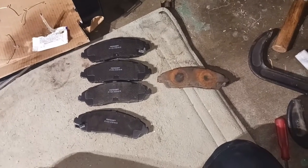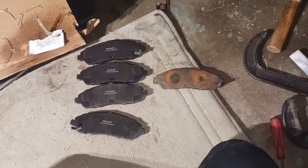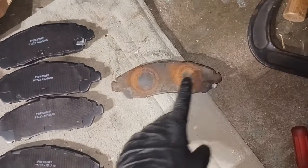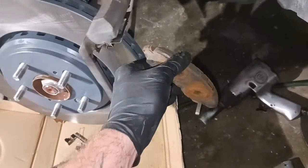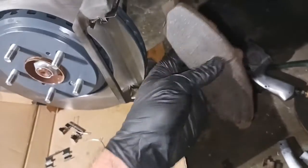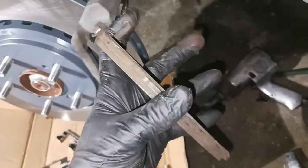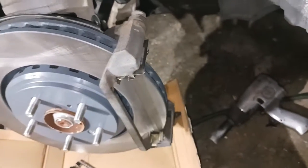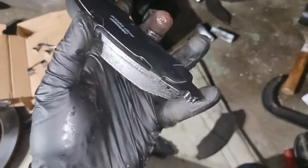This is the passenger side of the vehicle — front right if you're in America. It has this little thingy right here, and you'll notice the little piston cups pushing out on this guy. That means this guy is going to be pushing out like that, so that little tab has got to go upward towards the caliper like that.